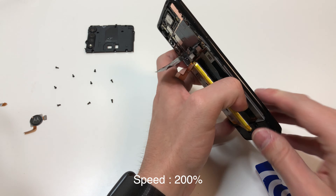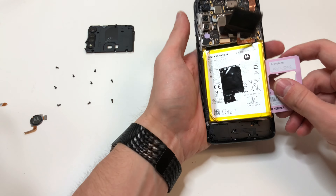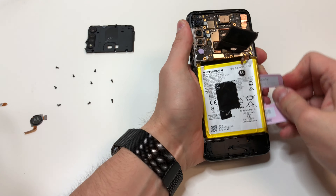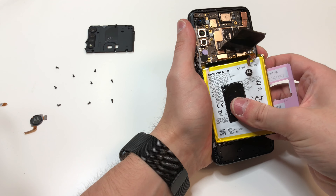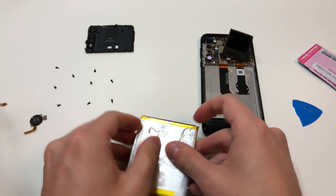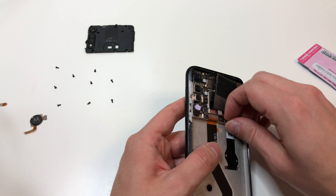Once you lift up the adhesive on the right side, put the card on top of the middle cable and cut through the adhesive on the left side. Make sure not to bend the battery too much — bending slightly isn't a terrible thing, but once you get the battery removed, if it does bend you can flatten it on the table. Just make sure it is a very clean surface and you don't want to puncture that battery.